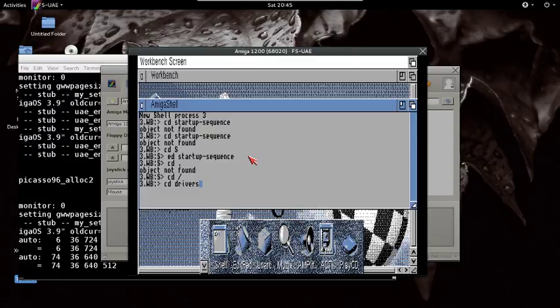We're gonna have to do this way. Amiga OS ROM update to Amiga OS ROM update dot back and enter. See, it's rename, not move. In Unix, it's move. In the rest of the world, it's rename. Okay, so when I'm bouncing between three different operating systems, well, you get the point. So we prevented the ROM update. We've actually renamed the ROM update, so it shouldn't call the ROM update, hopefully.